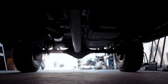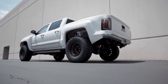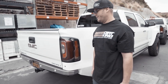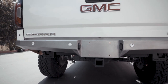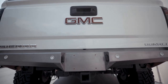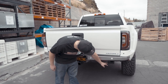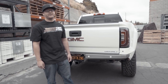We just finished up the back of the truck. We installed Fiberworks six-inch rear bedsides. We removed the factory leaf pack and installed the Deaver UNA2 pack, and went with a 37-inch Toyo RT mounted on a KMC wheel. Around the backside of the truck you'll see our Dirt King rear bumper, which eliminates the factory bumper indentation in the bedsides and allows you to dovetail it up at an angle for a clean line. We put the factory rear bumper sensors back in, added flush-mounted LED lights for the license plate, and our new low-profile hitch. Hanging below the bumper you'll see our shackle and hanger kit, which allows for full droop out of the Deaver pack.